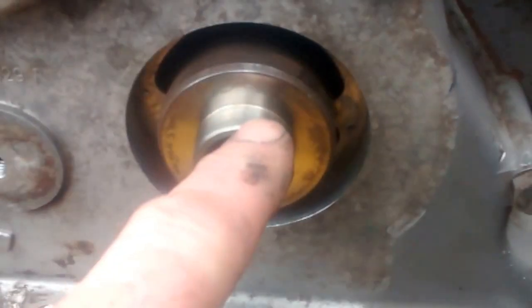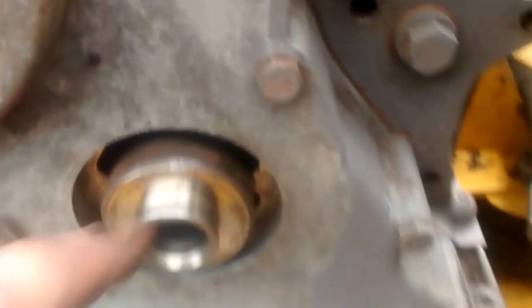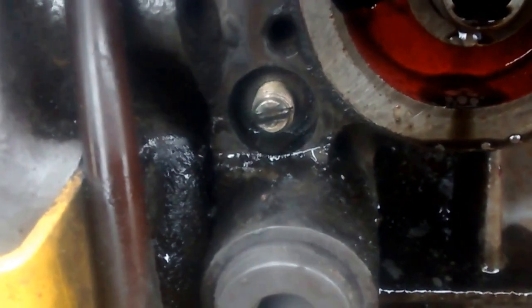As to keeping this timing correct, there is a YouTube video showing how to time these engines, which is quite accurate. It's to do with locating pins. The crank one is on this engine below the turbo and is there. The other one on the camshaft is on this side, just below the oil filter to the left. I made two locating pins up myself — the thread is UNC, I believe. Very easy to make, very cost effective.